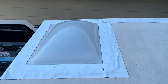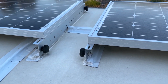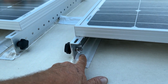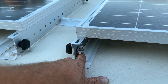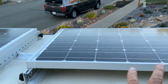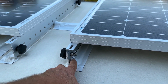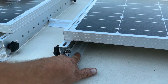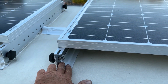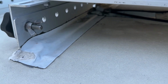Now let's go up towards the solar panels and take a look. So on the solar panels, you can see on the installation, I'll put in the description below this video a link to the video I did when I installed the solar panels. But I used well nuts and screwed them down, and then I put some Dicor here, and on top I put the tape. So I just did the tape for extra protection. It's been sticking fine, as you can see.